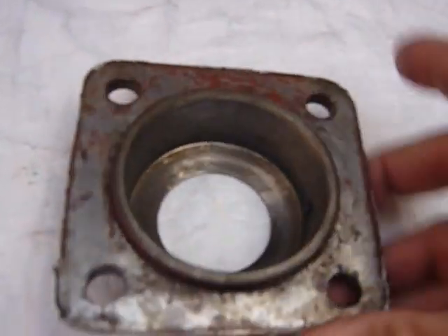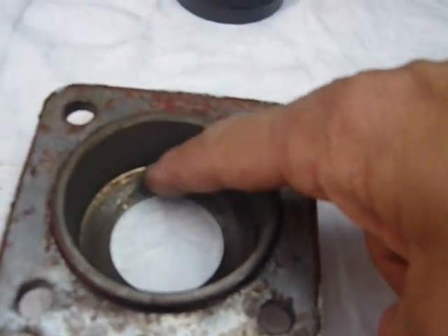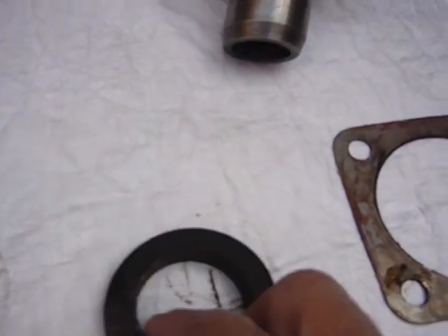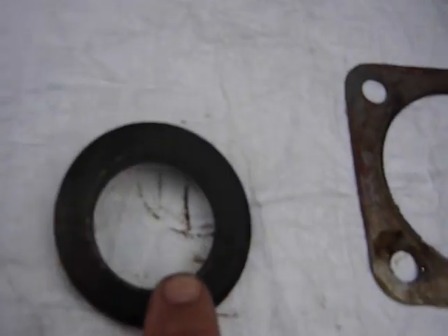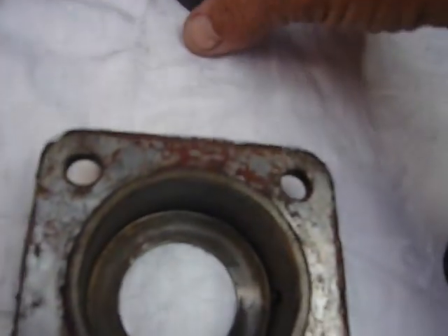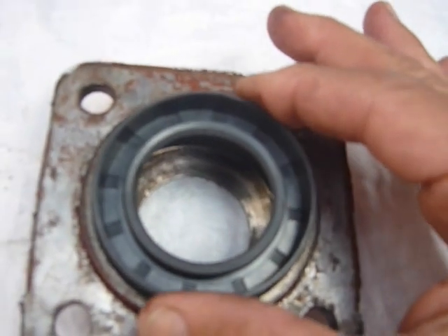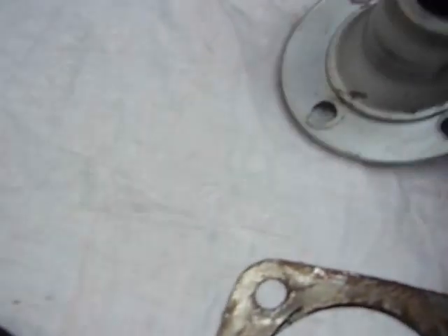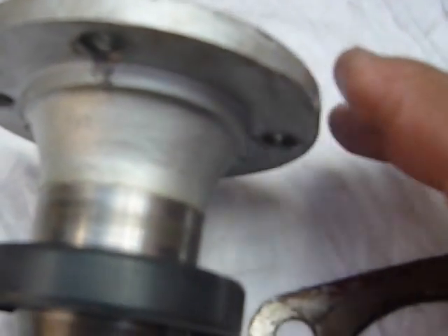I'm going to turn this over — you may or may not see on my camera, but in the bottom here it's tapered, and this piece here is also tapered, and they compress this piece which, as you can see from the shape, is tapered in the opposite direction. So we're going to lose the old seal, lose the old compressor piece, lose the big spring — or put them on eBay — and we're going to put this new seal in this way up. I'll have to press it in with the vice, and it will sit in there and stop oil passing by on the outer edge. It gets pushed in from the front and ends up sitting on the good unworn piece.